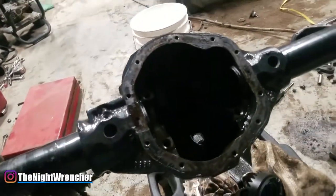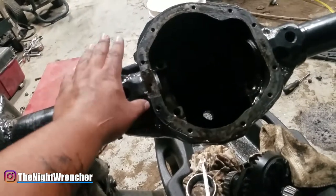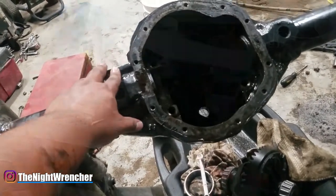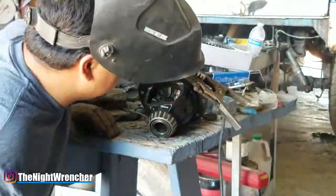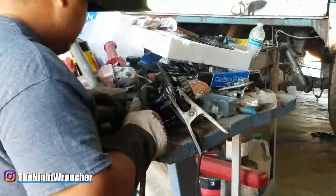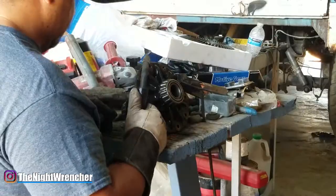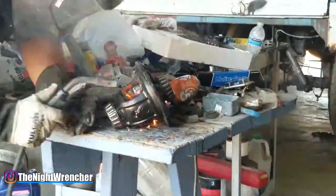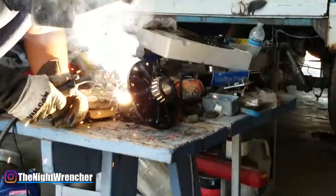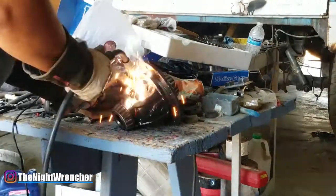I really wish I would have known this beforehand. Before you change your gear set on a Dana 44, keep in mind what gear set is in it right now. If your factory differential came with 3.73 gears or lower — like 3.25, 3.55, or 3.09 — and you decide to go higher like 4.10 or 4.56, you're going to need to buy thick gears. If your current stock carrier already comes with 4.10s, 4.56s, or 4.88s, then you need to order standard gears, because it's already positioned correctly for a standard thickness ring and pinion.